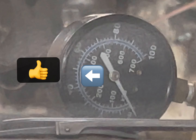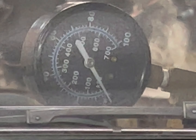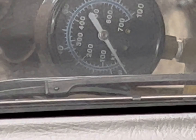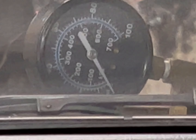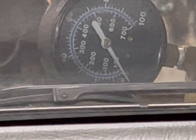On these LT1s, 41 to 47 PSI at engine off but fuel pump on is what you want to see. Usually 38 to 40 or 41 PSI when it's running. We should watch that gauge jump up to at least 40 pounds or more as we crank the key on. And we got nothing.